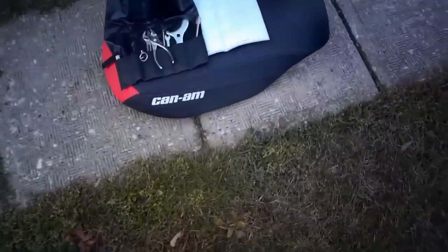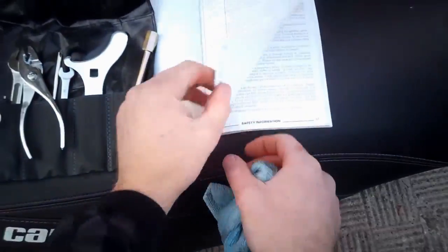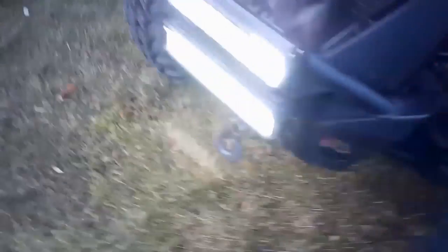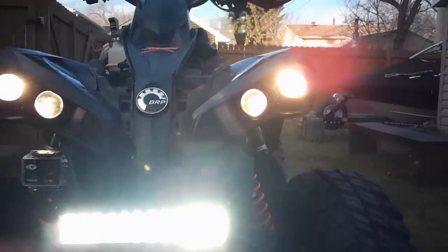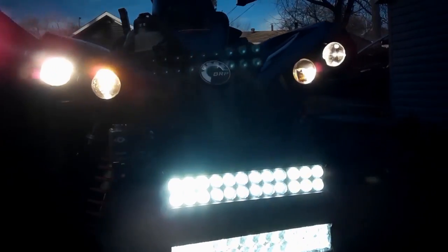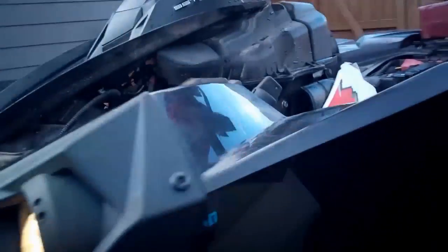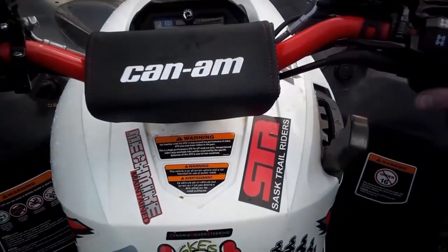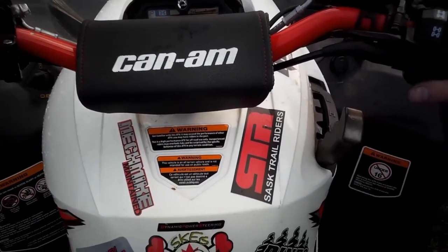On the other side, that was the CVT intake. I want to make sure that screen is clean so that my clutches run cool. This is all in the owner's manual — I'm just going through it step by step and adding some things I know I want to check on top of it. All my lights, my aux beam LEDs, those two 12-inch at the bottom — everything's working up top. Our daylight hours are getting very short here over the winter, and I want to do some winter riding with this unit come dusk.